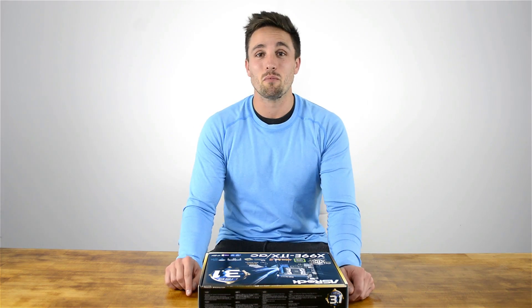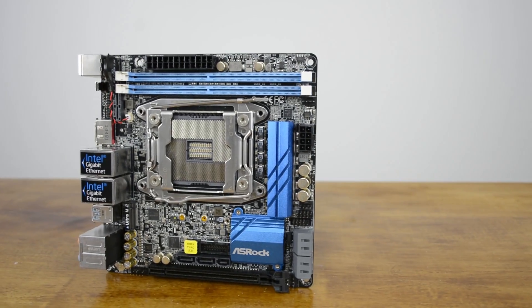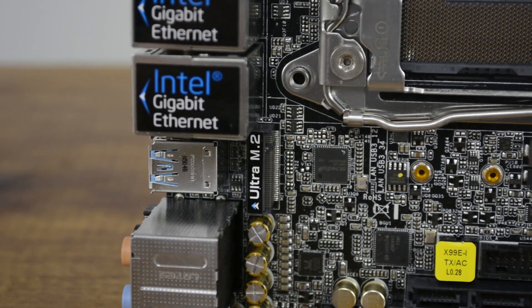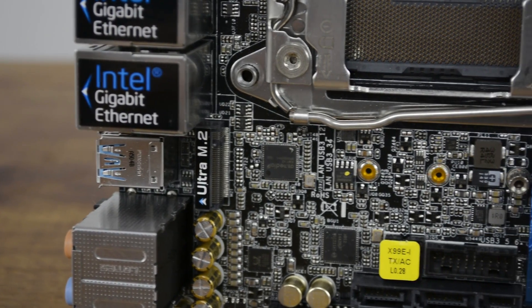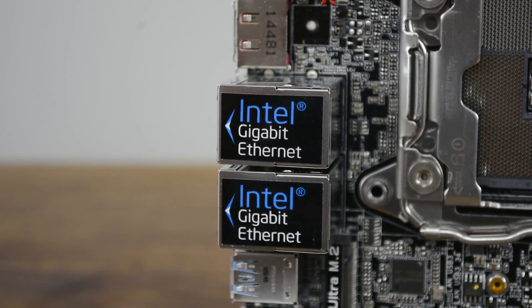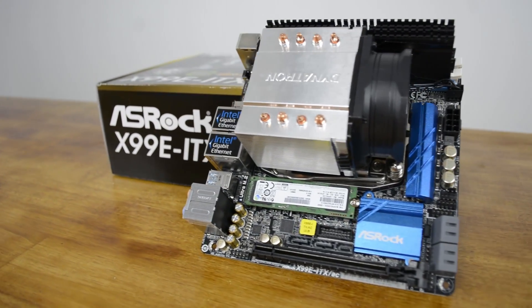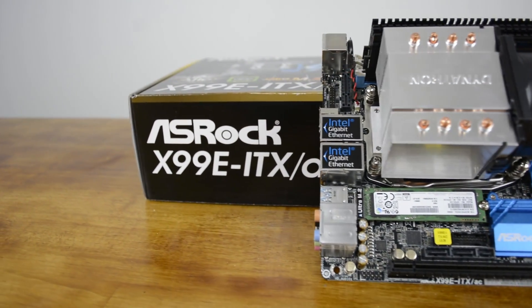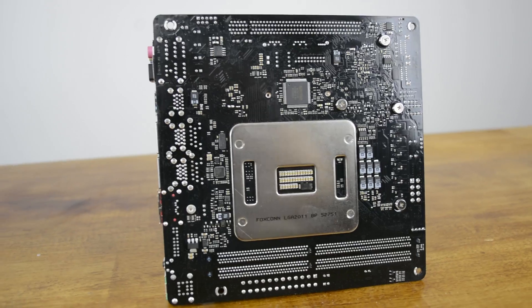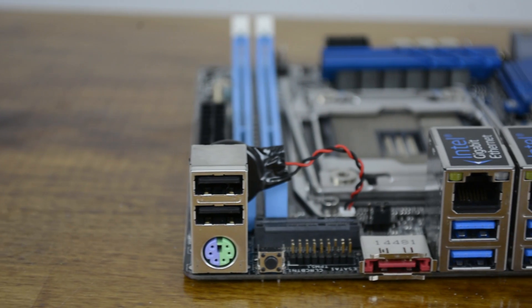This is something you would have thought was impossible not too long ago, but ASRock has really pulled it off. They've made it work so well that you get premium features like wireless AC, USB 3.1, SATA Express, and M.2 support. The only real trade-off is that you're limited to just two sticks of RAM, which rules out the quad channel feature of LGA 2011-3 processors. But is it really a significant trade-off in the real world? We're going to investigate and find out a little later.